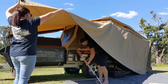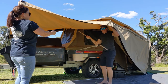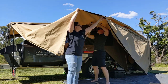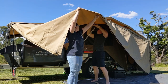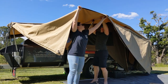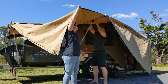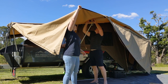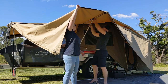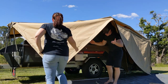We'll have photos of exactly how these go on. You push the little split pin through, and then on the awning right up the top there is a section that the base of the pole slides into — there's one here, it's all about just getting it at the right angle. Now it's tightened and locked. There's a little velcro section here — you velcro that onto the pole to hold it in place. We'll just keep it nice and low and lock it in place. It's just going to sit there.